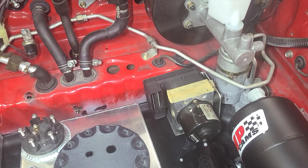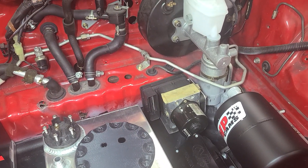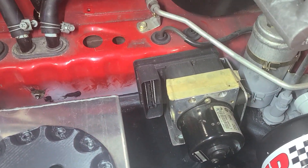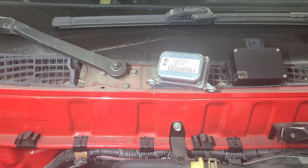I had the company spec the whole kit up for me and they built a wiring harness, which is the hardest part of the whole thing, considering all of your wheel speed sensors need to be shielded. There's the pump for the ABS. Up top I have one of the yaw control sensors that I'll need to mount to the chassis — that's kind of my next step.